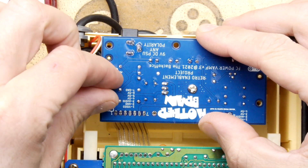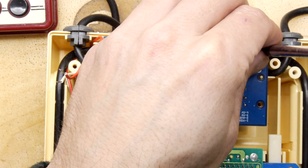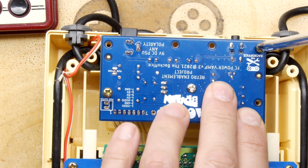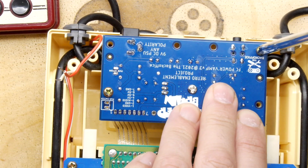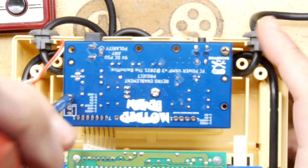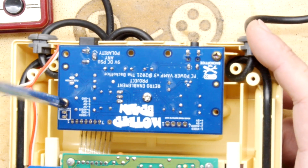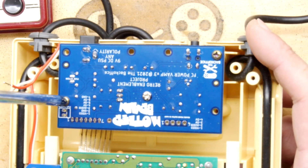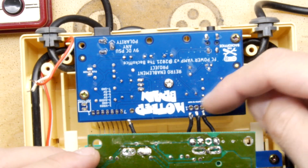Now, if we bend it down, because the ribbon cable is pushing up, it's putting a force going upwards — basically keeping them in the right place. So it allows us to put in a couple of the screws right now, and that just keeps everything in place. So when we want to apply solder, it's not jostling around trying to escape. I reckon this is going to be a good one, Lorne. I think the condition of this Famicom looks absolutely stonking. I think it's going to work. And before I solder that in, just to show you — there are other pins and the other pins are for the other style board. So you can see there is a slightly different pinout configuration.